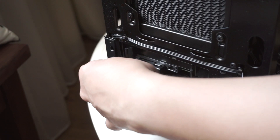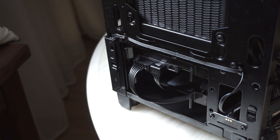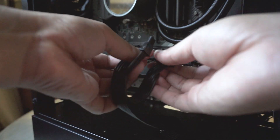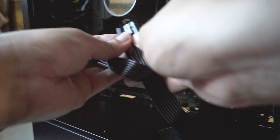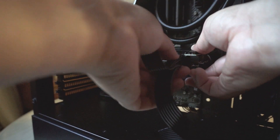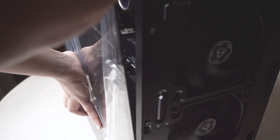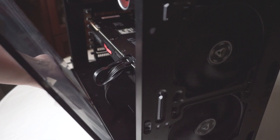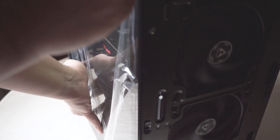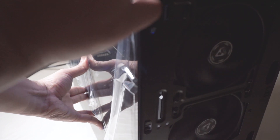Since a single SATA cable has four connectors, I just had to use one cable and was able to connect both my hard drive and my SSD. Connecting the PCIe cable to the graphics card was also easy. I had no issue connecting to the RTX 2070 Super, which requires an 8 plus 6-pin connector. As the PCIe cables are pretty rigid, there was a bit of pressure when I placed the tempered glass back — nothing to worry about, just something to note. I was able to close the tempered glass afterwards.